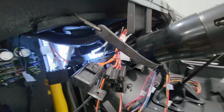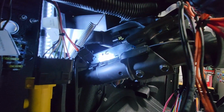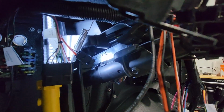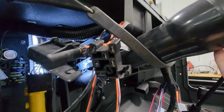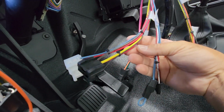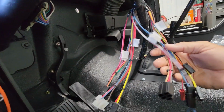On the steering column, and this is for anybody, obviously, if you're building your Jeep right now, you need to adjust your brake switch so you can hook it up, but it is not easy to get to, to make sure that you are getting proper contact in there. As you can see, I had to actually drop the column down a little bit. And then we're going to hook up our turn signal hookup and our ignition wires. And these will hook right into the column, into the plugs there. These ones will be saved for later.